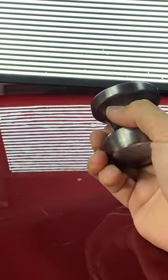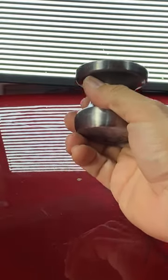And now I'm going to make a high on purpose. I'm going to use this edge now, okay? And I'm just going to slide it, pick my spots and push on top of the edge, okay? Everyone's just checking it out. So I'm using that, look at that. I'm just rolling the edge on the sharper lows of that dent, okay? Now, let me zoom in a little bit. I'm going to move my board out just a little bit. And now you can see that little light crease dent there, okay? Let's see how good we can get it. And now I'm just pushing straight up with that sharp little edge, the backside of that. Pretty cool.